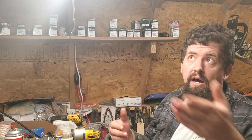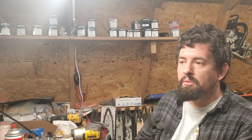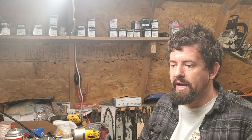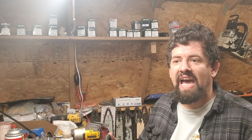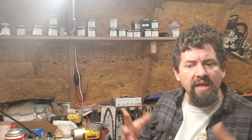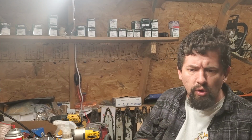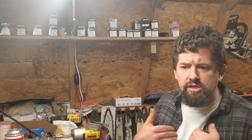That's not 100% how Permatex MotoSeal Gray's instructions say to use it, but that is what has never failed me. That process has never failed me. If it has ever failed, it was my human error. I missed a spot, I got wet thread lock on it, or I had oil that hit the Permatex when I put my piston and stuff together. It was always human failure.